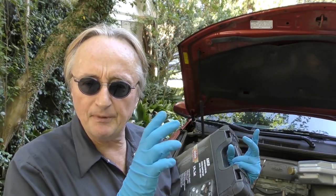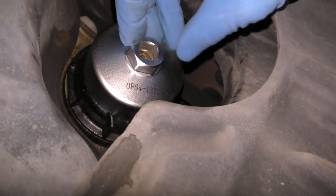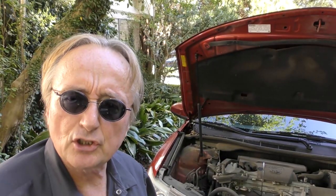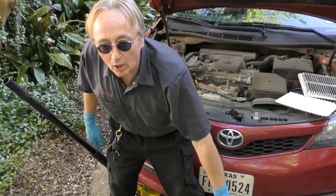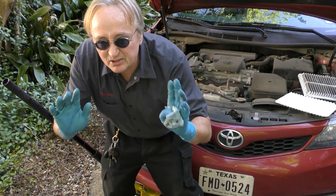If you're going to change your oil on any of these modern Toyotas, a lot of them have those paper filters inside a plastic canister, so you need one of these kits to fit on and get it off without the plastic breaking. Or use a giant extension bar, because these plastic things get on tight — it's a horrible design. Use a quality oil that's the right spec: this one uses 0W-20 and it's SN Plus, which means it pollutes less. You get a much better chance of passing emissions if you use the right amount of oil — in this case 4.7 quarts. Using the correct oil in a modern car is very important, not only for engine wear but for the pollution it puts out. Don't skimp and use cheap oil.